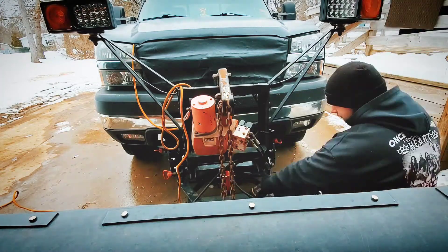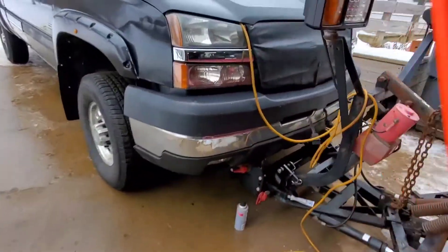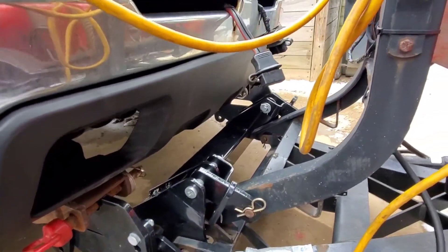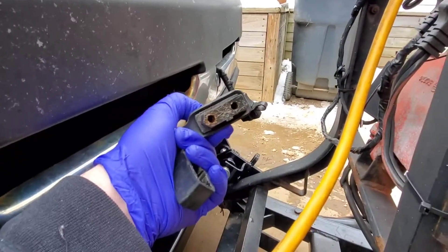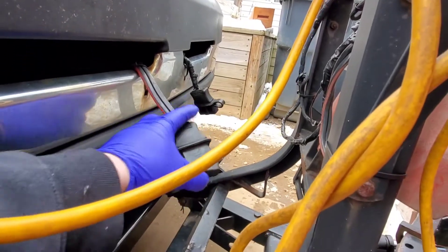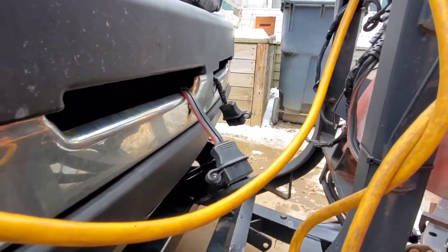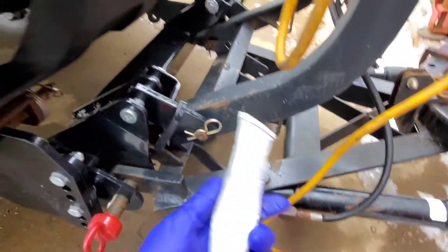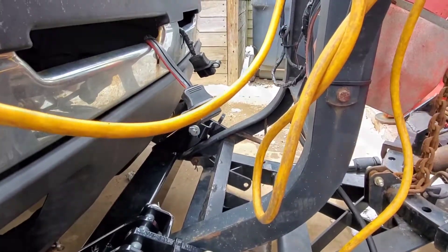Now that we corrected that mistake and we're all hooked up, the jack is lowered and out of the way. In the time lapse you'll notice I opted out of hooking up the electrical connectors — they get beat up between storms. These rubber caps are nice, they keep out the majority of stuff, but they're not weather tight. So I'm gonna take some mass airflow sensor cleaner and some dielectric grease and repack them so we don't have this issue.